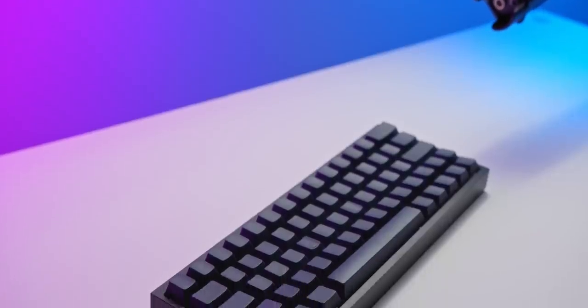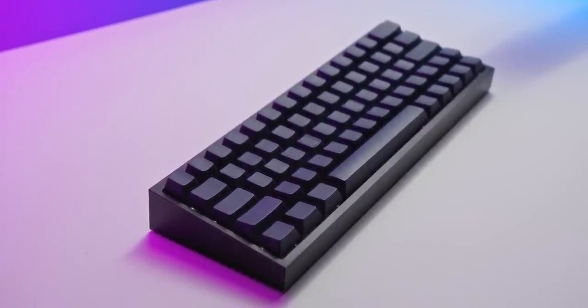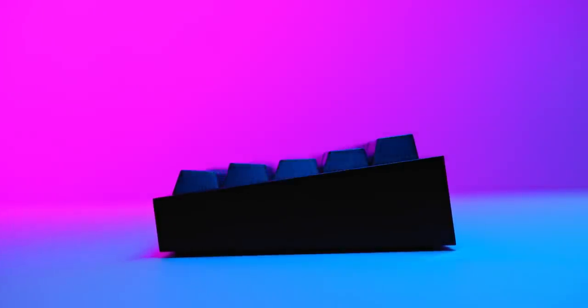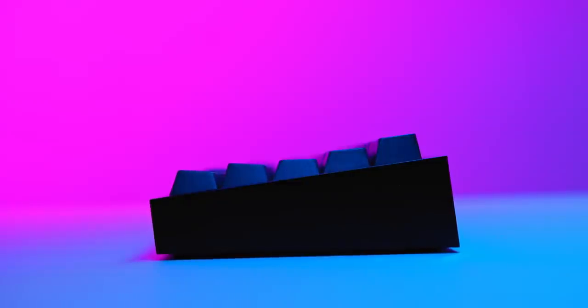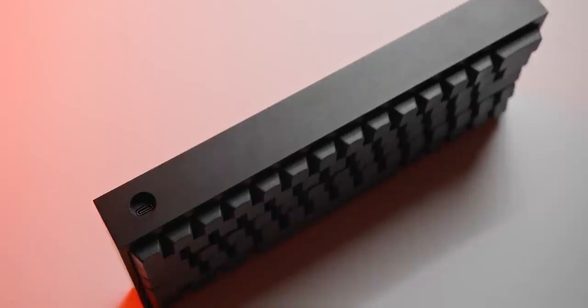After about two to three months I swapped to the keycaps you see here — the Enjoy PBT blank keycaps in black. It sounds weird if you haven't built a custom keyboard before, but this completely changed the feel, sound and interaction with this keyboard. These are Cherry profile keycaps, quite a bit smaller than the SA profile I was using initially, and I can definitely say all of my keyboard builds moving forward will use Cherry profile keycaps. They're so much more comfortable to type on compared to SA profile, especially for gaming, and in fact all of my wrist pain and discomfort went away as soon as I swapped to these.